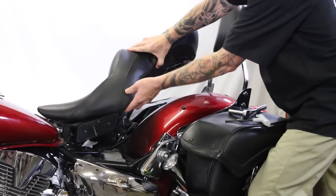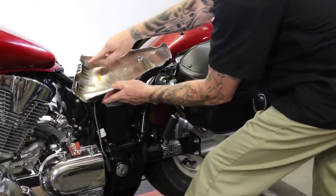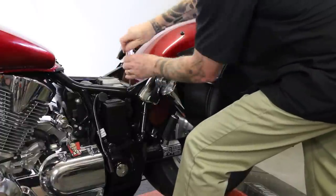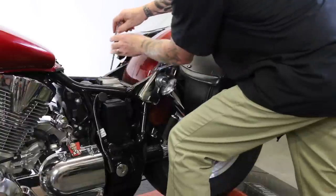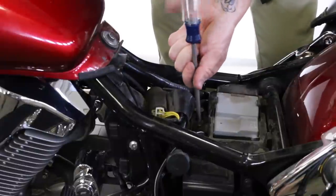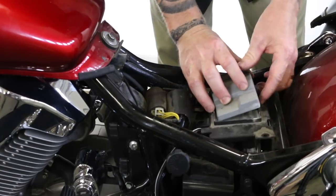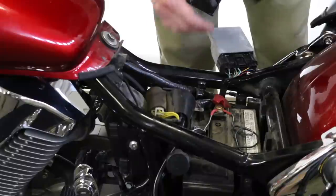And there goes the seat. Now we have the seat off. On each side of the bike there are some chrome trim pieces that pull out — pushed into rubber grommets and connections, real similar to a Harley. By pulling those off, we're going to get access to the battery and some wires. There's a plastic tray that sits over the top of the battery. Ryan's going to take some screws out, and once he gets that little guy out of the way, he's going to pop the ECM over and disconnect from the plastic tray. He just pulled the plastic cover off and we have access to our battery.